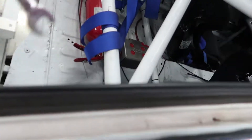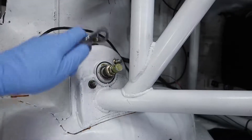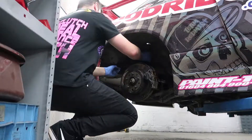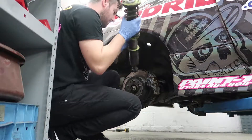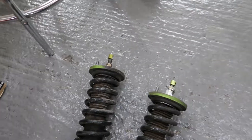For me, the CS2s were kind of the budget option. I thought let's do some research, try those and see how we get on. If I don't feel they're making the car drive how I want it to, then perhaps I'll upgrade again in the future. Luckily, coilovers on an S13 couldn't be easier to change - two bolts at the top, one bolt at the bottom, easy. Coilovers are now off and on the floor - as you can see they're looking a little bit grubby, worn out and tired.